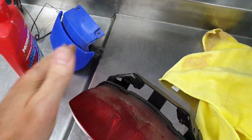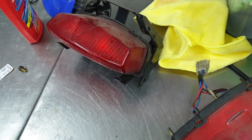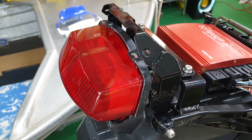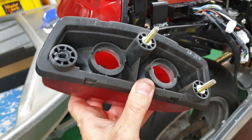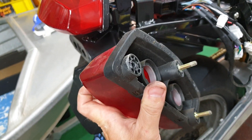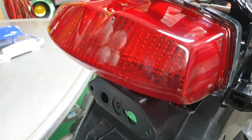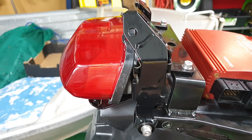Before I can fit this panel, I've got to fit the grab rail. And before I can fit the grab rail, I've got to put the tail light in — which means I've got to pick the best tail light out of these two, clean it up, and fit it in the back of the bike. I've got the tail light all fitted with all the bracket trees on. I had to sacrifice the other tail light just to get all the rubbers out of it — you can see where it had started to spin in the housing, so I'll run this one for now. There are a couple of fine scratches but she'll do for today, and I'll see if you can still buy them.